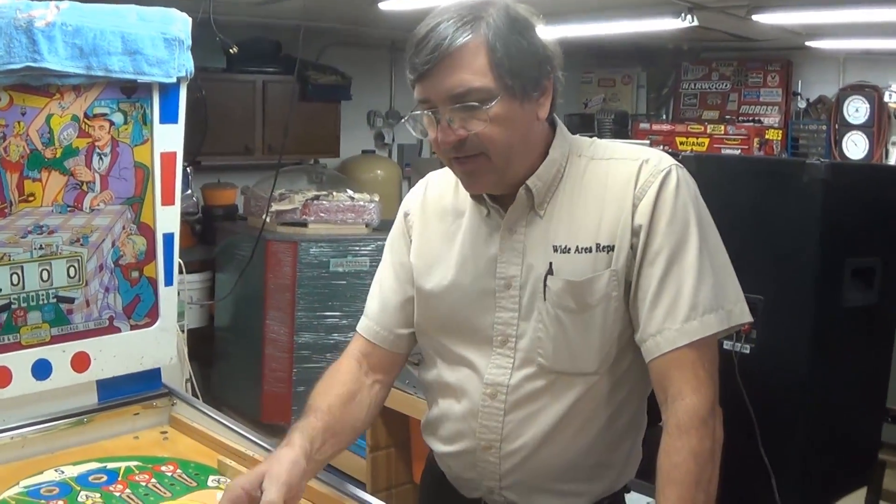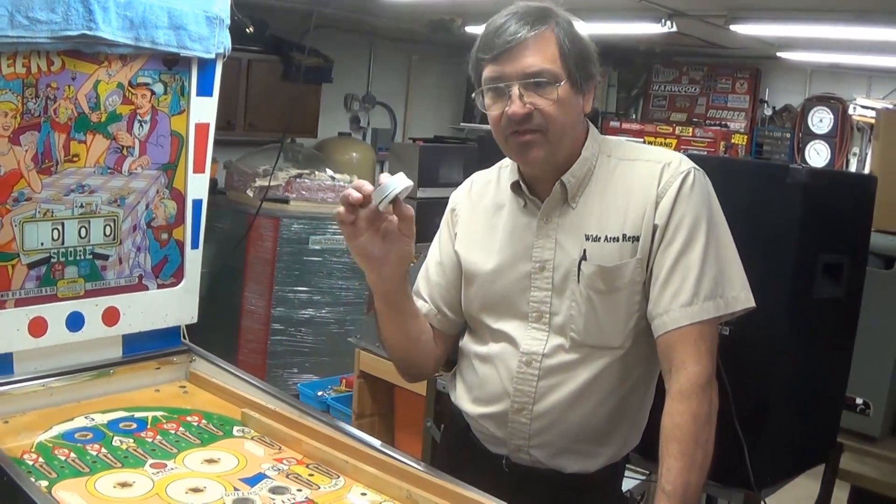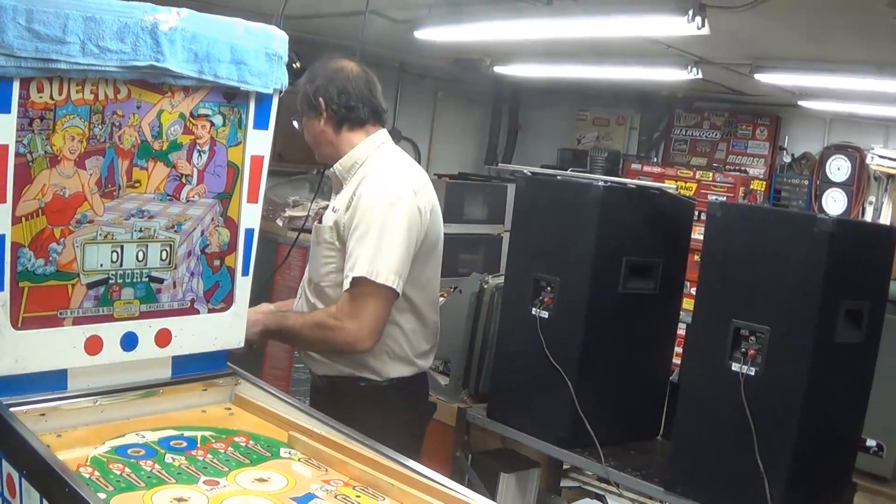This is something you get at Lowe's or Home Depot — this works fine. I find it works as well as stuff specially made for electronic work. All you're using it for is to improve the heat transfer of the soldering iron. Using flux with the braid keeps the heat low and the solder pool maximum — without it you'd have too much heat on the board for too long, even with the braid.